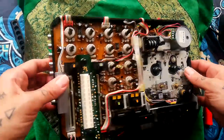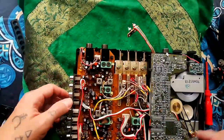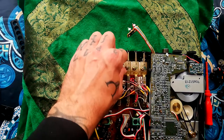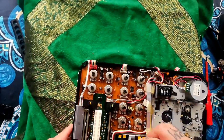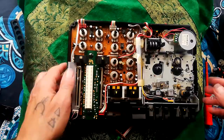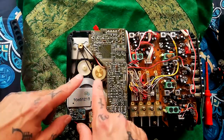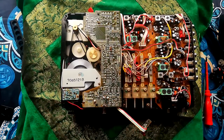With the outer case removed, you can see we've actually got pretty good access to this board — you can access it from both sides without detaching it from the plastic chassis. When I was first taking this apart, I removed all the screws from this big chunky mechanism. But you don't have to unless you need to re-lubricate or replace belts on the transport mechanism, which is something I will be doing. For that, you do need to remove this PCB here.